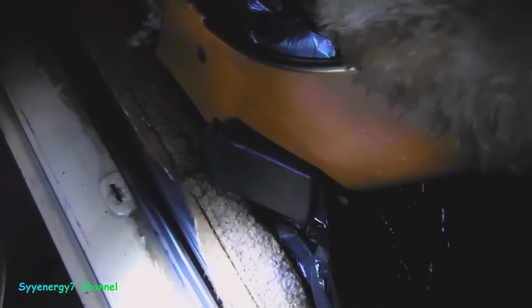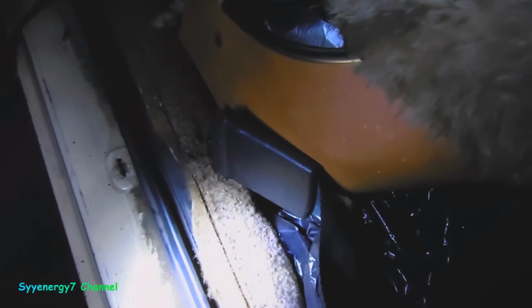And then after all that's done, we're going to come through the top here and fill this up with cosmoline. I'm probably going to drill some holes in here and put some plugs, because the aluminum kick plate covers that piece back there. I'm going to have one here and one here with a rubber plug, so I can stick a vacuum cleaner in there with a tiny hose, like a 1/2-inch hose, and an air gun, and also cosmoline it. Make sure these rockers never rust. It's going to be an ongoing project, but let's get this part done. Let's get this coated up with rust converting primer and then a coat of paint, and we'll make that plate. Takes a little longer than I thought, but it's getting done.